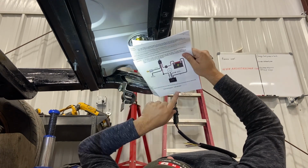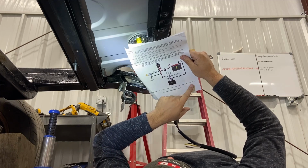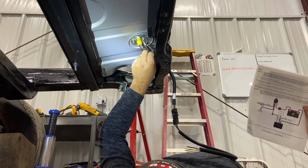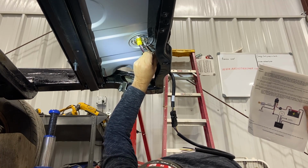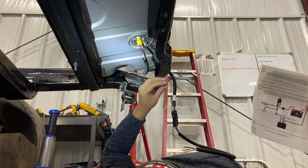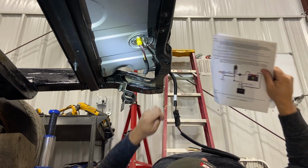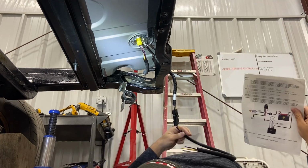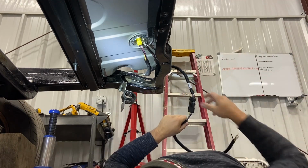And to make sure any rubber hoses or clamps are rated for EFI. Yes, you are correct. Make sure everything is rated for EFI because she'll have enough power. Nice little caps, I keep them. But yeah, fuel injection will blow regular line.